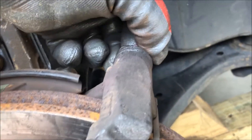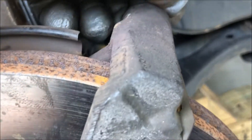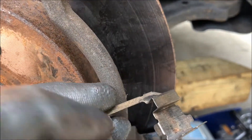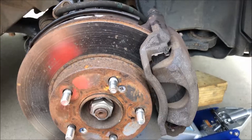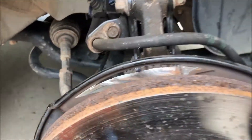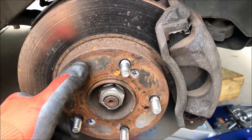Without taking the shield off I was able to bend it back pretty significantly, so there's no more dragging on that heat shield. I've cleaned and greased both pins and they are floating very nicely now — that should not be a problem anymore. What's left is to clean and grease the last retainer clip so the brake pads float properly, then reassemble. The brake is now reassembled — much easier to turn with no dragging sounds. That heat shield probably should be replaced and I'll make that recommendation to the owner, but at least the noise will not occur anymore.